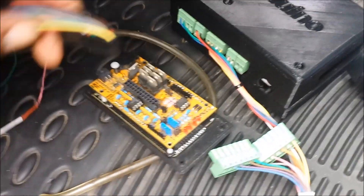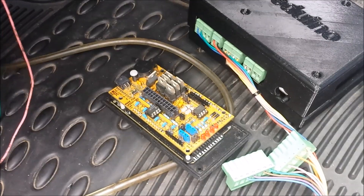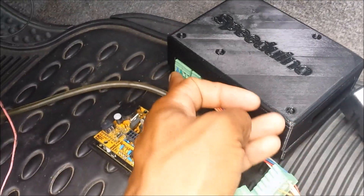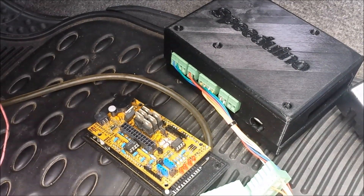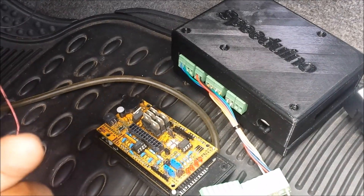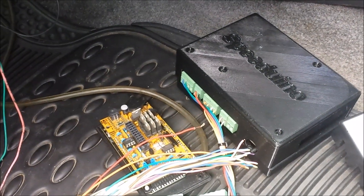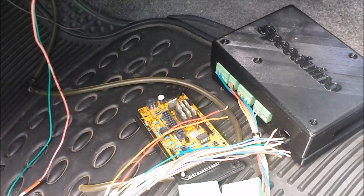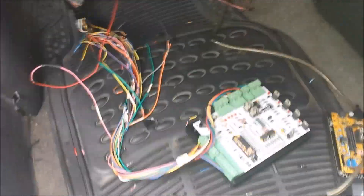This one has screw terminals, the no2c has this plug, the v0.4 has an IDC cable — they're all pretty much the same. It just boils down to what you want your finished product to look like and how skilled you are. I recommend the v0.3 to newbies because it's a lot simpler to make a harness — you just open this up, use a flat-end screwdriver, and connect your harness. Others would require soldering or crimping, and most newbies are a bit intimidated by soldering. I put a detailed write-up on the Speeduino forum — link's in the description — on how to connect a Speeduino to an OBD1 or OBD2 Honda or Acura. We're now halfway through the madness.